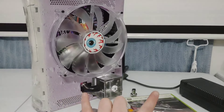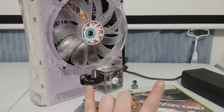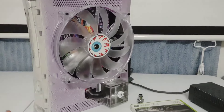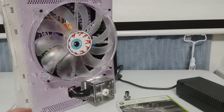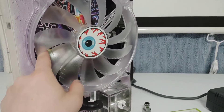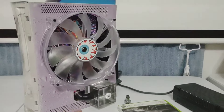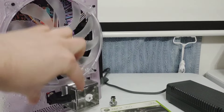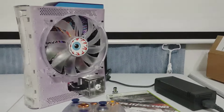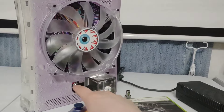What makes these kind of unique is I only have two XSPC Xbox 360 fat specific water blocks. It's something you just cannot find anywhere - for a long time you haven't been able to buy them. They're nice because they fit the stock system underneath the DVD drive, and XSPC made a rectangle block that goes over both chips with the fittings on the side next to the DVD drive.